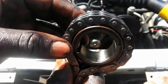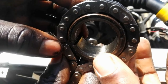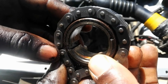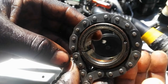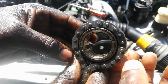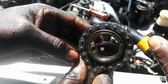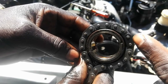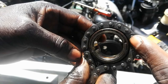On the crankshaft side, I'm going to show you — this is the gear which goes on the crankshaft side. On this gear, if you just want to make sure, put your engine on TDC, make sure it's on TDC, and then you can put your chain. Now on the chain, I'm going to show you where the mark is — where the mark on the chain is supposed to be. As you can see, there is a mark there where I'm pointing; that is the one which is supposed to be in line with the mark on the chain.